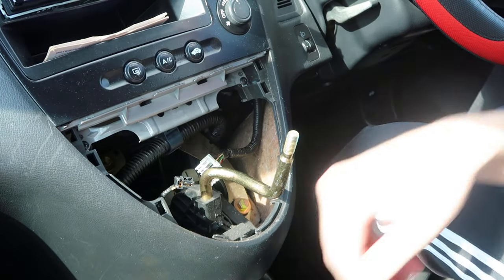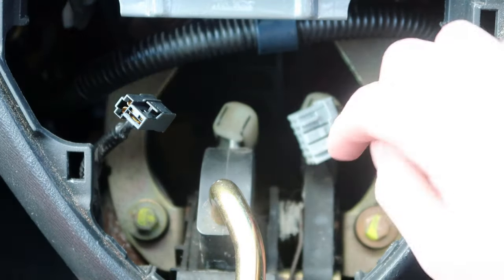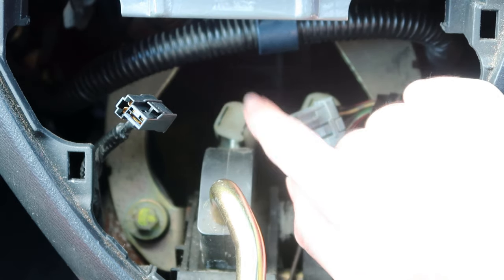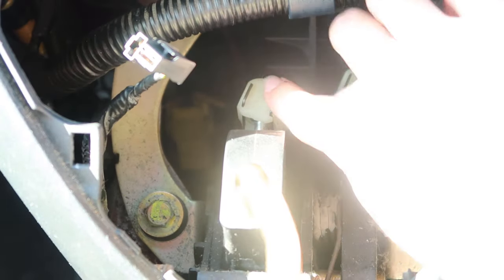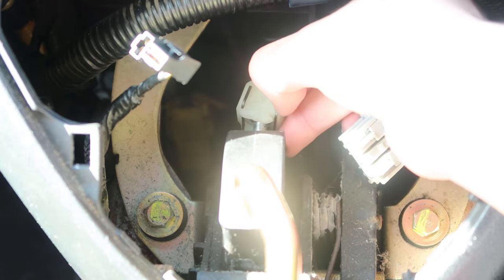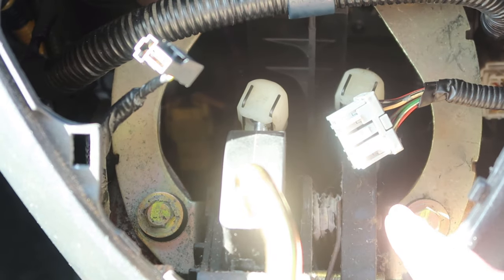With this out of the way we can see our gear stick. If I put the car in fourth we can see it more clearly. This plastic bit needs to be popped off. The two allen key-looking things hold a spring - make sure to not drop anything down in there. Balance it on the outside while taking it out and keep your hand underneath so the spring doesn't fall into the gearbox.